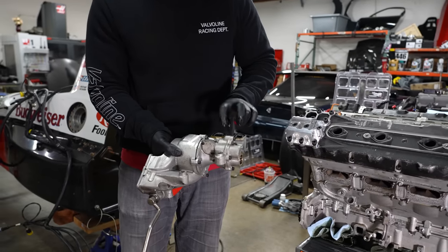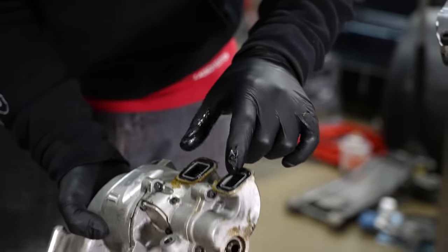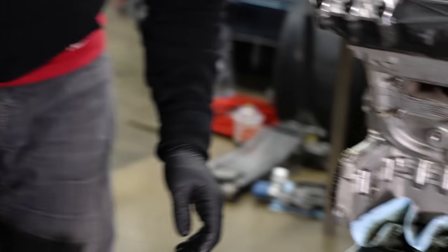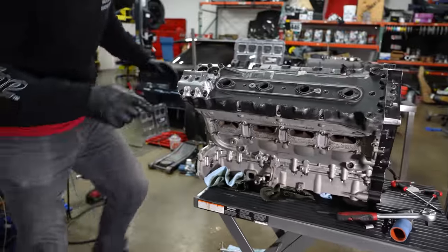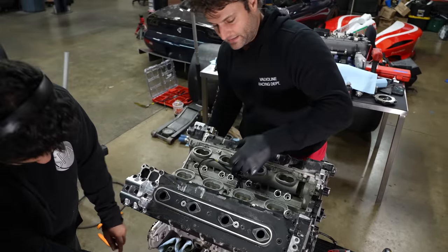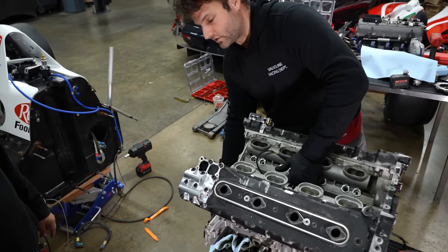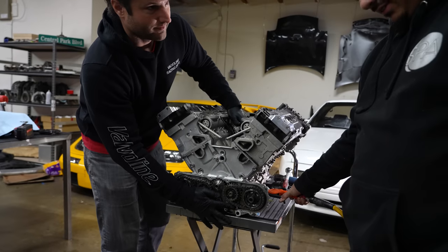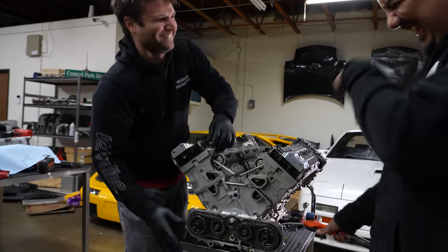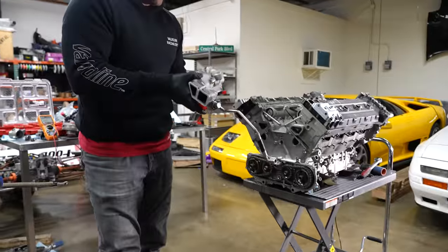I also remembered that earlier the oil was leaking out of this side from these two here. With this spring in place, it's making me wonder if this is an oil pressure regulator or the oil pump considering its position. Isaiah's got the air compressor and we're going to test this further. That very clearly means that this is an oil pump with regulator. Oil in, this is oil pressure out.